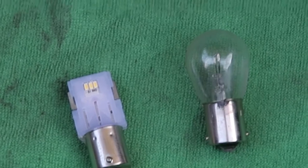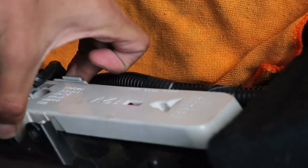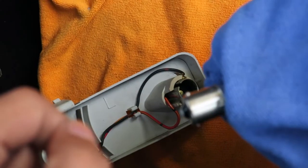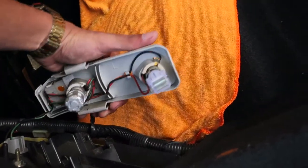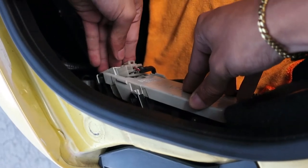Here's a side-by-side look — huge upgrade. One more time on the driver's side: grab onto both tabs, press down, pull straight out, grab the light bulb, twist counterclockwise and pull straight out. Grab your new bulb, line the notches up and go straight in, press down and turn to the right. All you want to do from there is line the bulbs up with the hole, try not to hit them on the frame, and push firmly to hear a click.